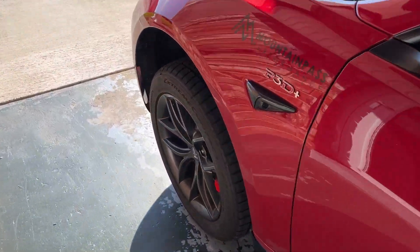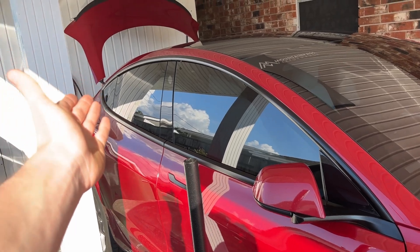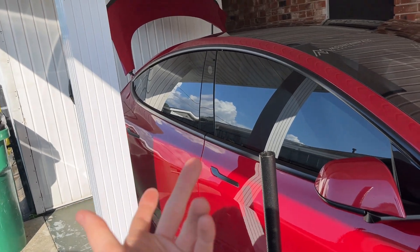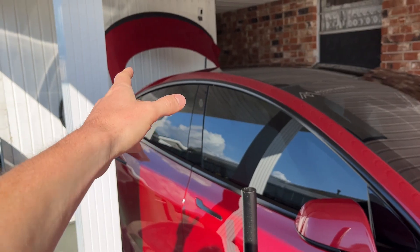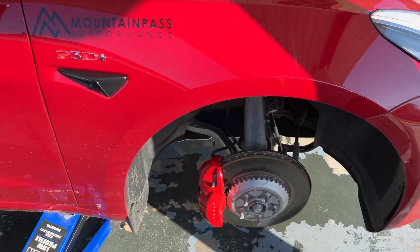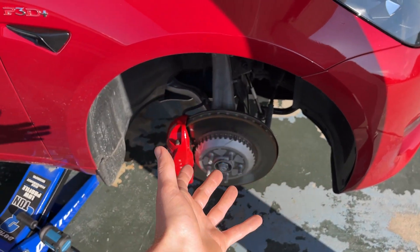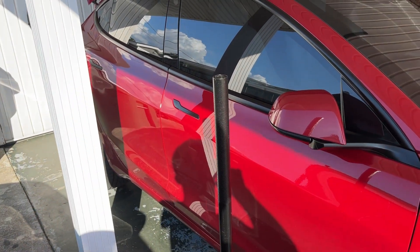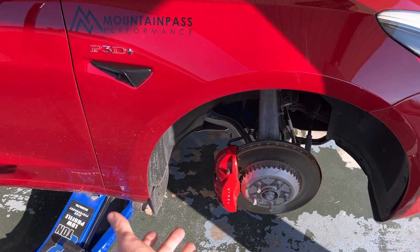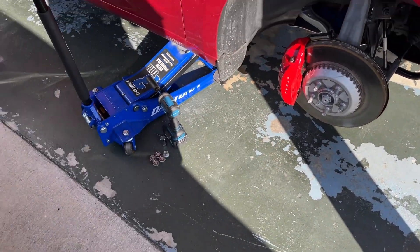This isn't hard to do — it really just takes about $350 to invest in the torque wrenches if you buy the good Icon ones, which run about $100 each. The small quarter-inch one from Pittsburgh is like $20. The three-eighths-inch and half-inch drive Icons will run a little more, but it's worth it with the lifetime warranty. Anyway guys, I hope this video helps Model 3 Performance owners know that it is recommended to re-torque your suspension. If you're somebody that just gets in and drives — that's great — but you're going to end up having problems and having to go to Tesla service. They'll probably charge you $400 to $500 to re-torque the suspension when you could have done it yourself with a torque wrench and a jack.